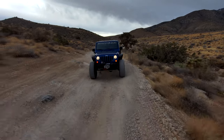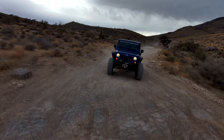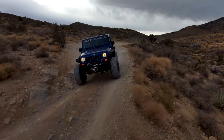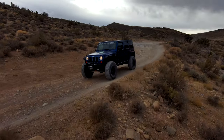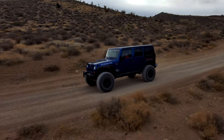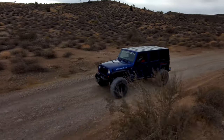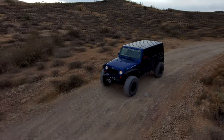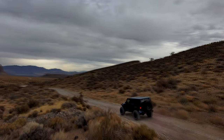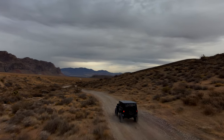When we got back to Vegas, I decided I didn't want to sell this Jeep. I know that the live axles and the full frame is what I wanted. So if you look at your vehicle, you have lots of modules, dozens of modules. In this early JK, we have the TIPM or the gateway module. We have the cab module, better known as the instrument cluster. We have the wireless module. We have the tire pressure monitoring system module. We have the sway bar control module, the SAS, that's the steering angle sensor. Of course, we have the PCM in this, which is the engine and the transmission controller. We got the occupant restraint module. We got all these modules. And a lot of you don't know how complicated some of these newer vehicles are getting.